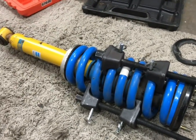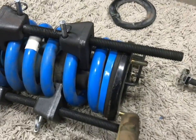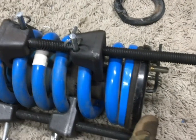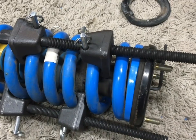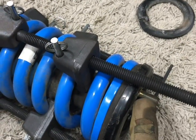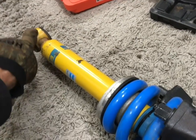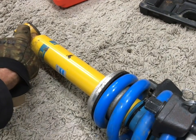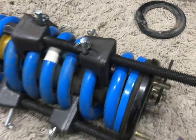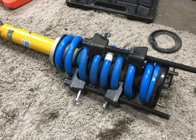In this case, on this Gen 3 Montero shock — 2001 to 2006 — you want to pay attention to the orientation of the studs on the top hat. Those need to be a certain way or else it's going to fight you when you go to reinstall this; they're not going to line up with the holes in the body. A quick way to remember this: line up any of these three studs in the top hat with the flat portion right here on the shock, so it runs along that imaginary line — and that will make it go right back in, easy peasy. Thanks guys, I hope that helps you out.